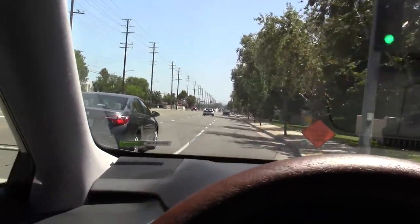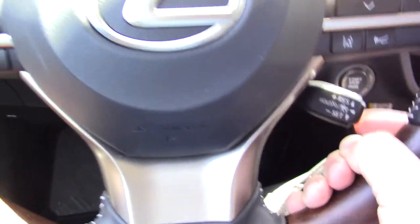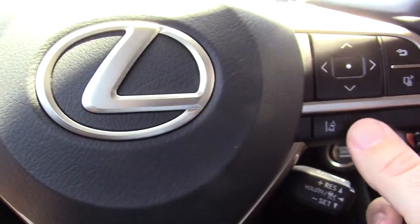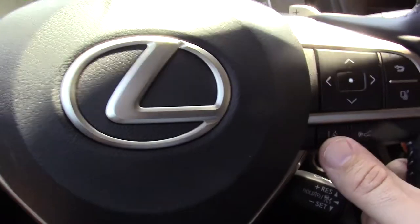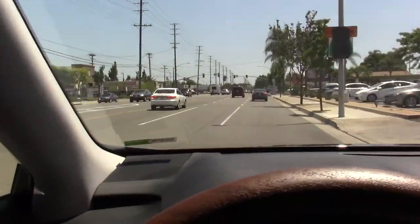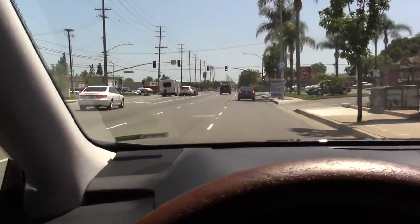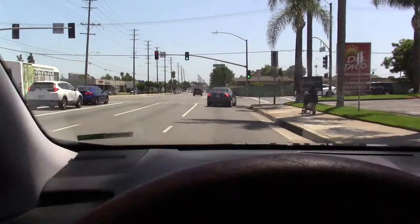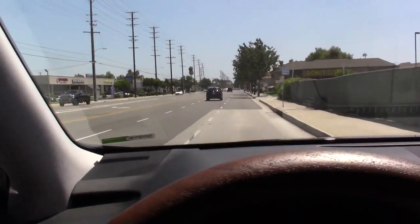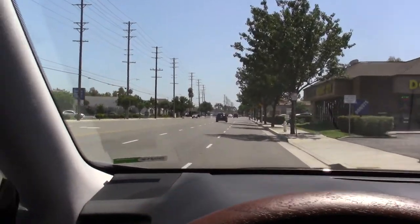That is pretty much all I have to say. Push this button to turn it on, bump it down to set it, up and down plus or minus to change the speed, bump it up to resume, pull it towards you to cancel, hit the brake to cancel. Push this one to adjust your following distance, and push this to turn your lane tracing assist on and off. It is a pretty simple system on the Lexus and it works well. So if you have one of these cars, try it out. Always drive safely and pay attention. If you have any questions, feel free to put those in the comments below. Thank you so much for watching — please like my video, subscribe to my channel, and have a fantastic day.